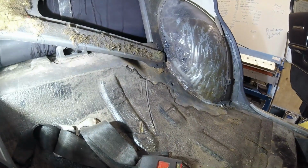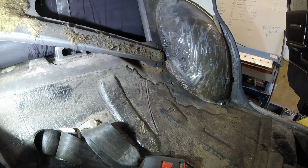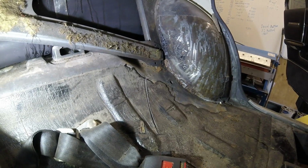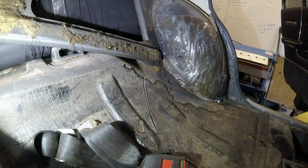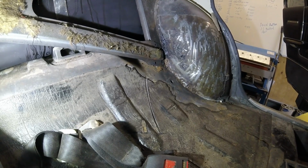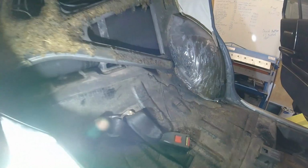And the biggest concern is that's a seatbelt mounting point right there, right next to it. So if anyone ever picked up on that for a warrant of fitness or a cert, it's just not going to pass. So you're going to have dodgy rubbish like that right next to a seatbelt mounting point on the chassis for the vehicle. In mine, we'll tidy that up.